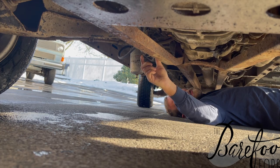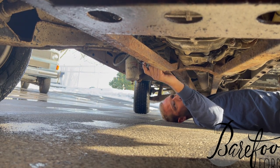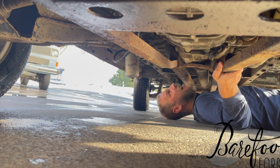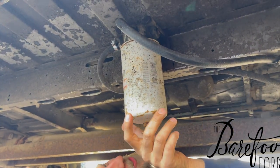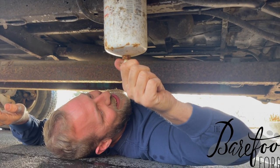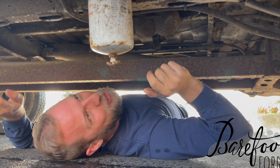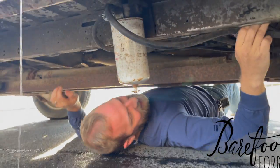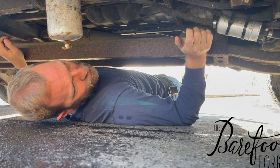This is very not correct — she's a dangler. Is she on the fuel tank straps? No. This guy looks like some jumpers. This is a brand new fuel pump, but it goes into that stupid filter — see that big dangling filter? That's easily knocked off. That's a good spot for having your entire fuel supply. I think if you've had major issues with your fuel tank... yeah that tank is probably garbage. Well it's plastic so it doesn't go bad, except it's probably sitting with only about five gallons — it needs a full tank.